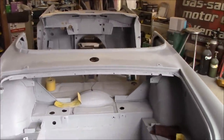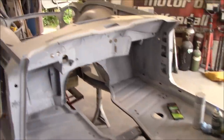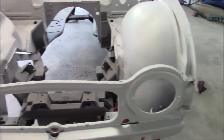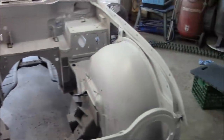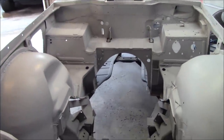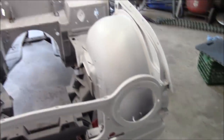That's going to be weather dependent, but I think I've got a little window in the next couple days. It's not prime painting temperature-wise — humidity is still fairly high — but I think we're just going to have to risk it and go for it. The car has now been sanded down, washed thoroughly, and dried. We're going to let it dry overnight. In the meantime I'm going to start taping up. I'm going to do the engine bay, passenger compartment, and trunk first, and then come back and do the exterior panels at a later date.